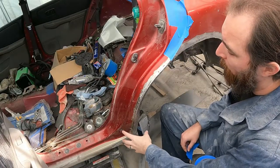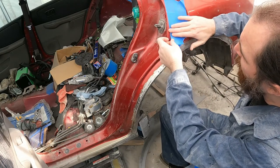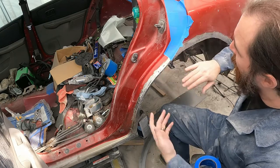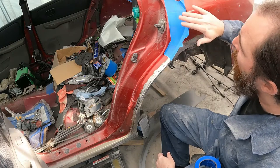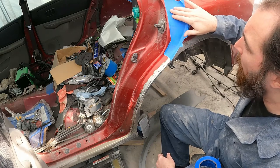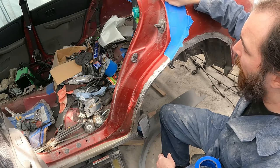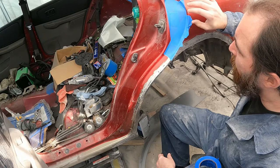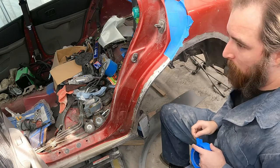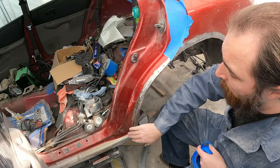This is the region we're going to build up. We need to take painter's tape and outline the region we're going to fill in — the area we want to adhere and build up the lip over. We'll use painter's tape first because it comes off really easily, and then we're going to put packing tape over that. Not only will it come off easily with the painter's tape behind it, but all the fiberglass stuff we're going to do will not stick to it — it'll just peel off like a candy bar. Prep work is number one.